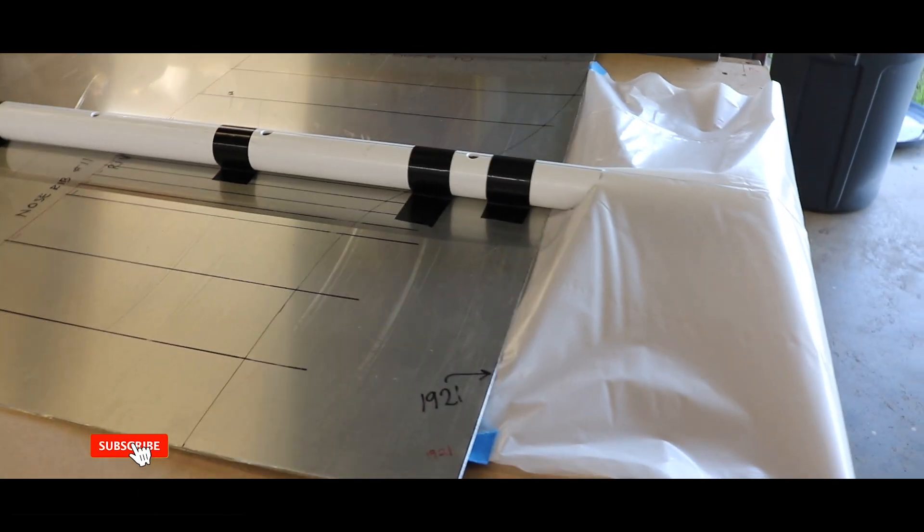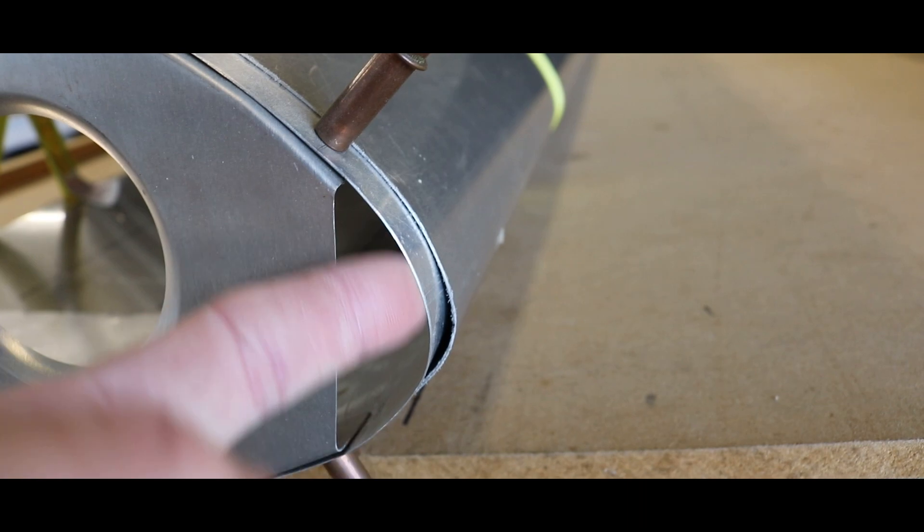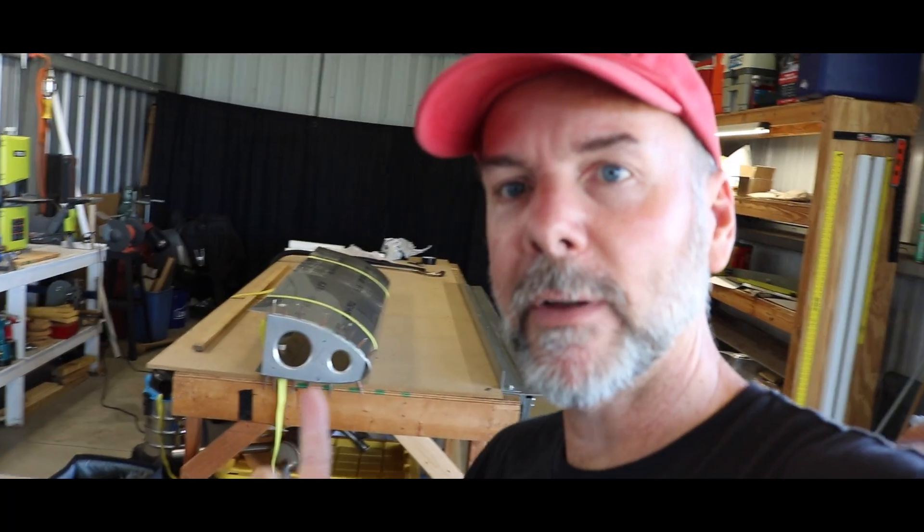As they say, the first one is your worst one. Actually it went out pretty well. I had to go back and run around fixing some leaks — I had way too much visqueen plastic, so in the future I'll cut out more of a template to make it easier to tape up. The PVC pipe pulled out a little bit because the tape sucked down on the tubing, so I'll fasten that down with more tape wrapped around the tube. The leading edge got a little bit pointier than I wanted, but once we rivet it in place and pull on the metal it'll be just fine. Where it got a little sharper is on the wing tip, and there's going to be a wing tip there anyway, so it'll hide a slightly off radius.